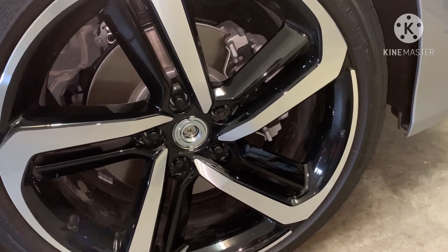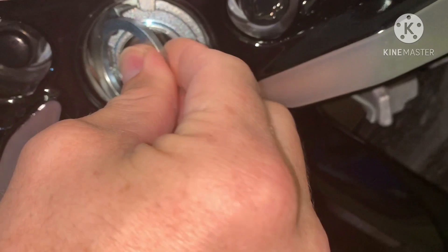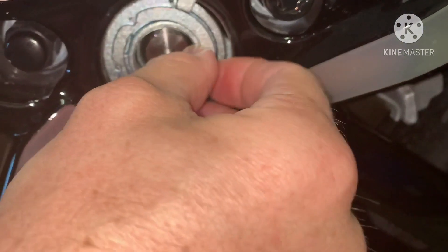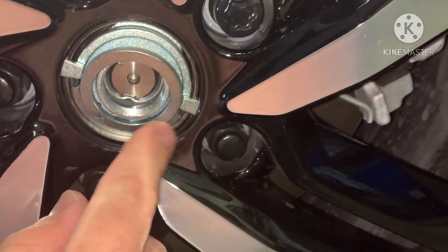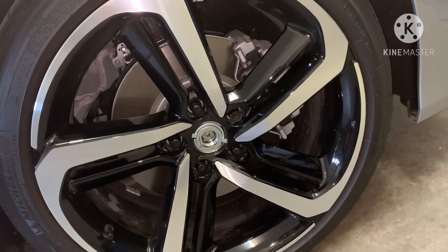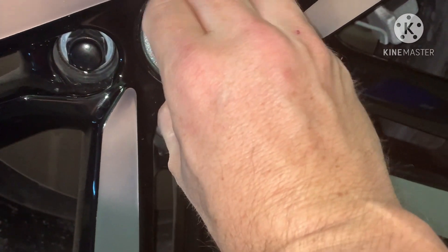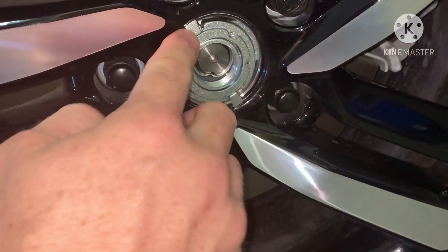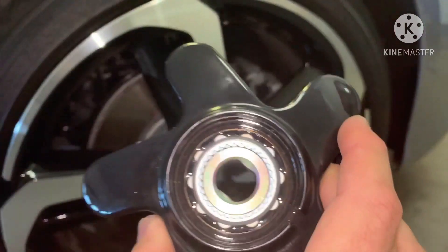You can spin the ring and then it locks in place — that's what prevents it from turning and sliding until you get the whole thing put together. It doesn't matter which lug nut you line up with; it just helps when putting everything together. You'll notice this only goes in one way — the ears won't tuck under the other way. So you get that in place and aligned. It will have a little movement on it; don't worry, this is just the base so the locking mechanism can attach.